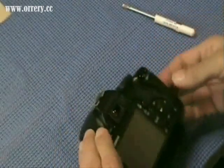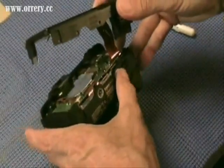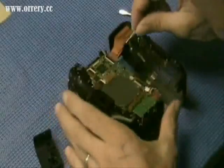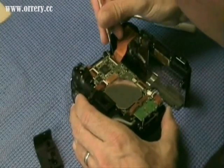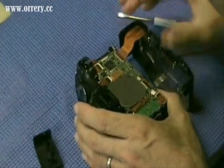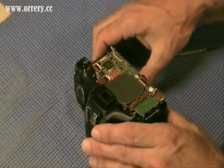All we have to do is pry the back of the camera off. Be careful when doing this — do it slowly. The back will be connected with a ribbon cable that we see here. It is connected to the circuit board on a ribbon cable connector that we need to work loose. This is a hinge type of connector. Using a small flat head screwdriver, we lift the black hinged part up and move it away from the ribbon cable, which releases it. The ribbon cable can now be easily removed from its connector. Both parts we place in a sealed container so that they stay dust free.